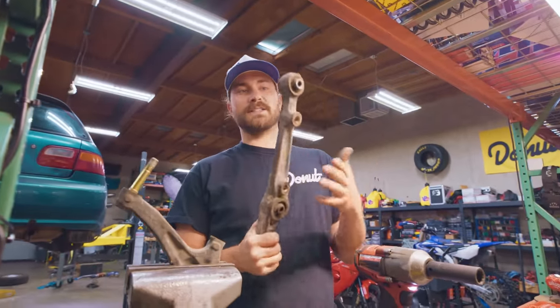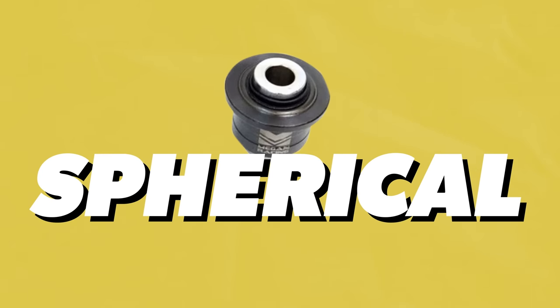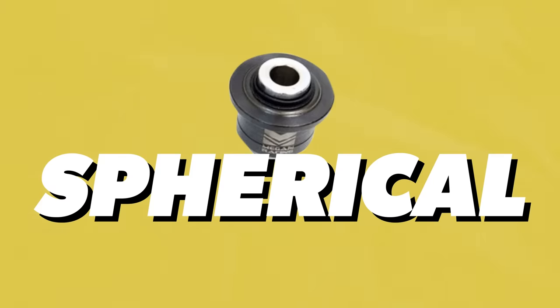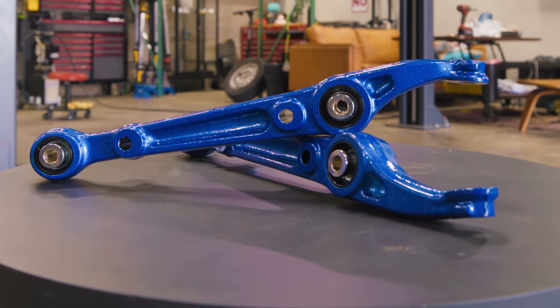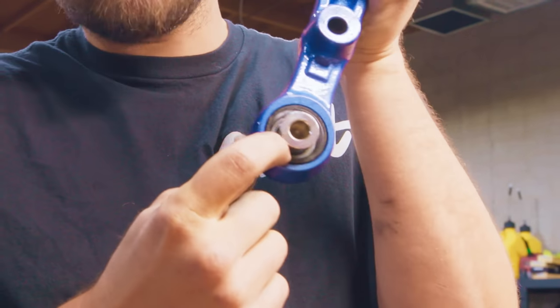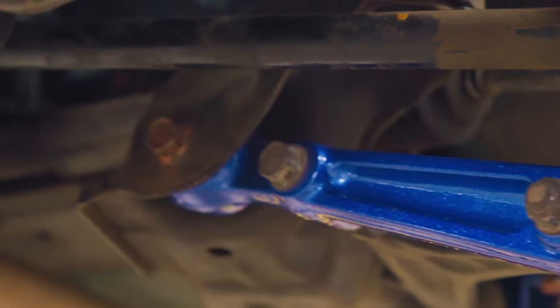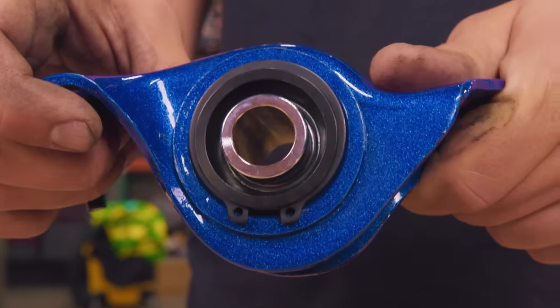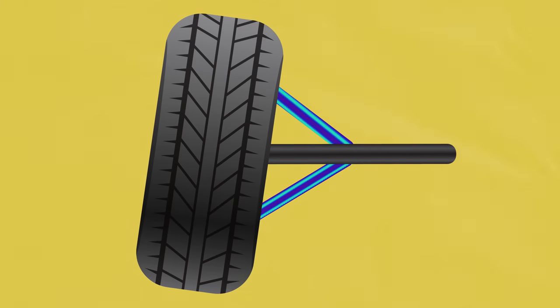You could press these out and replace them with new rubber bushings, polyurethane bushings, or with spherical bushings like we're going to be using. These come nicely powder coated with spherical bushings already installed. Basically that's just a big metal ball in a housing, which allows for rotation and angular movement so these can move with your suspension. But because it's a metal ball in a housing, there's really no deflection. So when you're under hard cornering, nothing deflects in any unpredictable way, and you get to actually make use of that alignment you paid for.